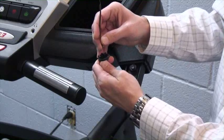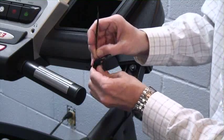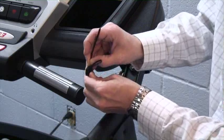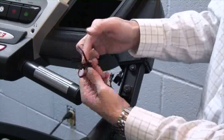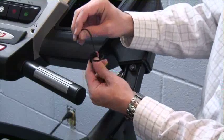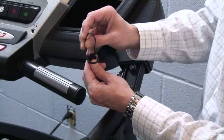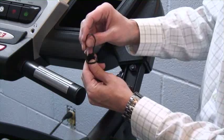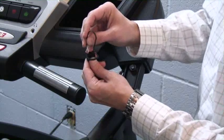We're going to attach pin 5 and have a positive connection on all three — 1, 2, 3 — and with our open end we're going to tap on pin 7, which is the first slot directly across from 1. Each time you tap the pin it's 0.1 mile per hour speed increase, so if we tap it 10 times we should be at 1 mile an hour.